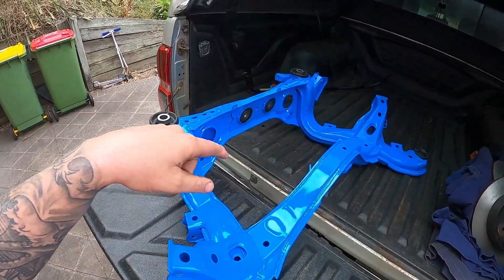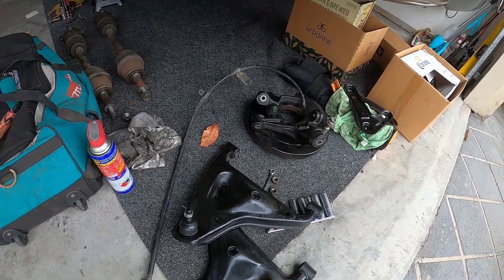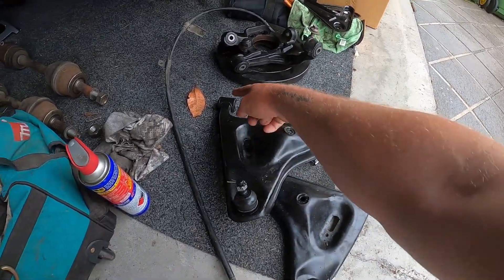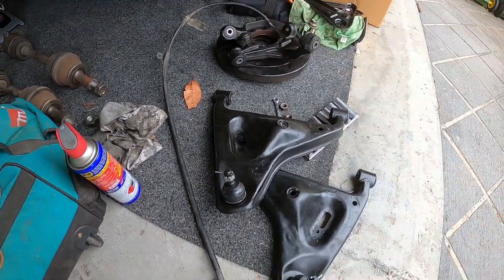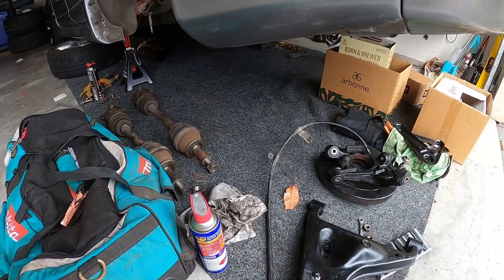Genuinely Nismo bushes all round. In the back you can see the hub, and I got brand new bearings as well because when the bearings were still sitting in the knuckle, they were quite flogged out — they had a bit of movement. While they were out, I figured I'd just replace them. Here are my rear lower control arms with all four new Nismo bushes, brand new ball joints, and the knuckles — Nismo, Nismo, Nismo, all refreshed with a quick hit of black paint. I think I didn't spray the CVs but I might give them a clean-up and a spray of black too, just so they look nice.